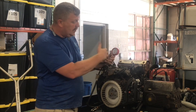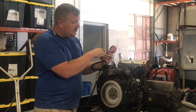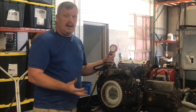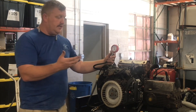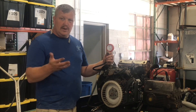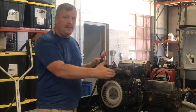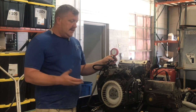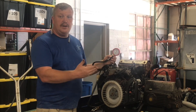That's what I wanted to show you with this compression test. If the compression only went up to 90 PSI on one side versus 120 on the other, then we would have a problem — that's where the 90 versus 120 difference matters. Most of these motors, what I've been noticing, is 120 is about right. Anywhere from 100 to 120, as long as both cylinders are the same, we'll be all right. Both at 120 — we are good to go.